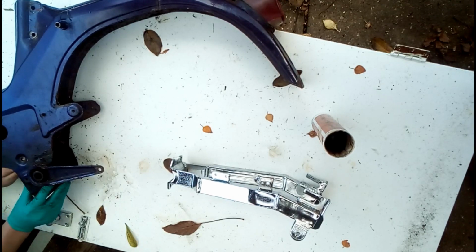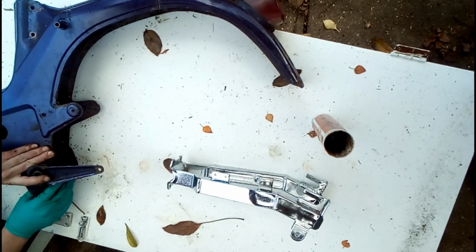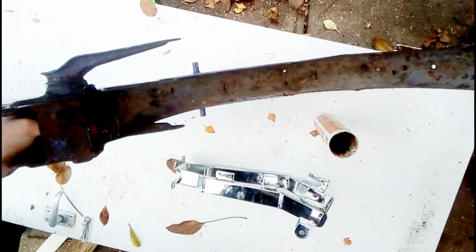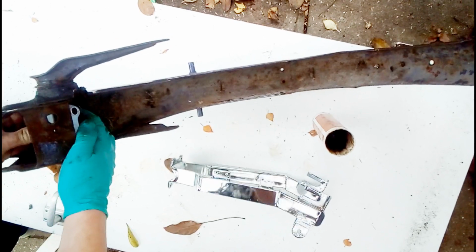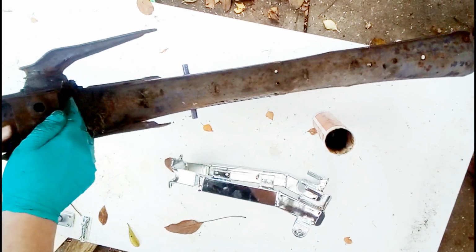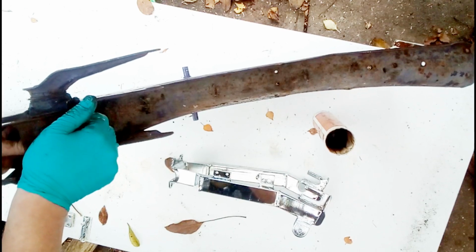So I've got the rubber bushing on, and now I'm trying to install that swing arm fixing plate thing that I was talking about earlier, and it is a bit of a struggle. The reason for that is I'm doing it wrong, and it turns out the correct way to do it is if you come in from what would be the back of the bike with it flat, put it on exactly the opposite of where it's supposed to be, turn it over 180 degrees on the pivot, so you kind of put it on and then roll it round to where it's supposed to be.